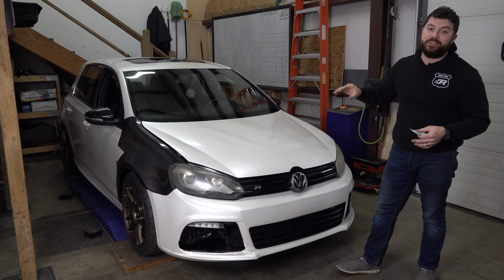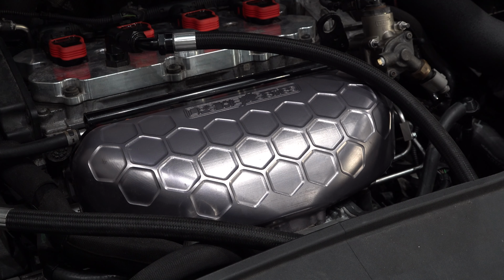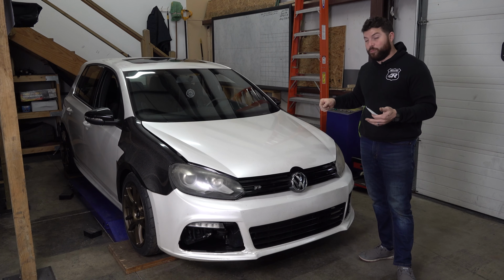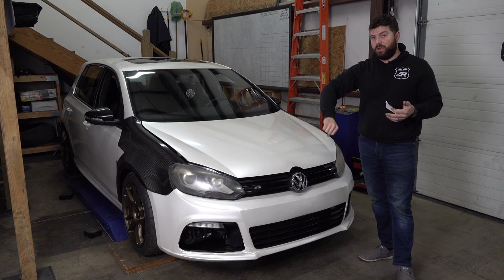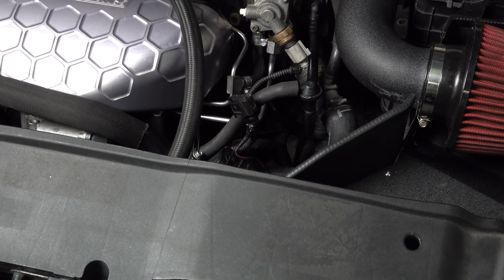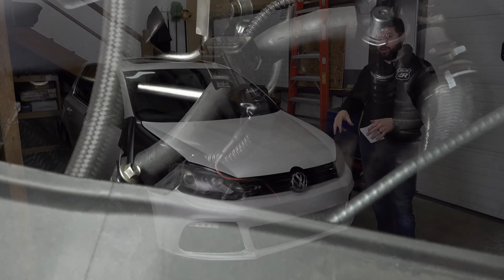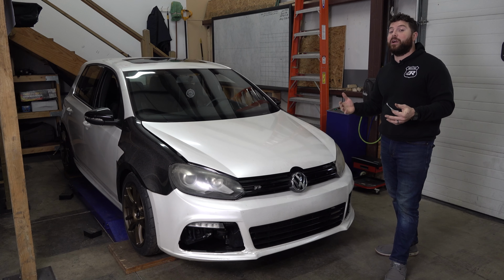So thankfully on this car, the intake manifold runners, that's all deleted with this new aftermarket intake. For a test, I was able to back probe the harness for the intake there, get 5 volts, run it down, and supply my MAP sensor. And right now I have it all kind of just jankily back probed, but it's working. So now the car can drive well.